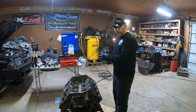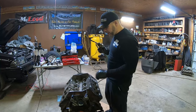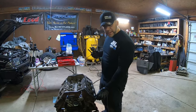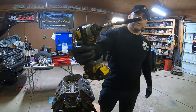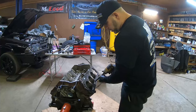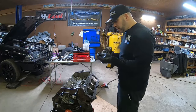Okay, so one thing that's definitely going to help me with the compression on this motor, because it's going to have some compression around 11.5 to 1, is the fact that this Cometic head gasket is actually 60 thou thick, 65 to be exact. You can see on the ARP head studs there's a coarse thread, which is the half inch that goes into the block. What I'm really doing here is just bringing them in so I can set the cylinder head on top of it.